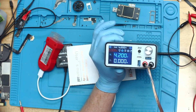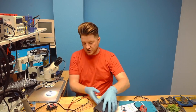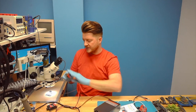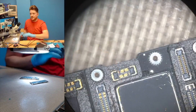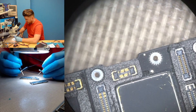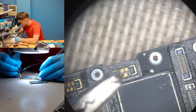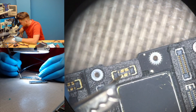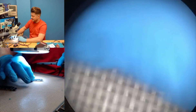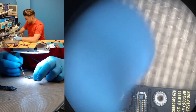So it's pretty cool and useful. I have an iPhone 11 here I wanted to show you. If we take a regular device and touch ground, then touch the positive on the battery connector, we don't get any voltage consumption at all. But one of the interesting things here is if we do the same thing on this device, we'll notice something different.